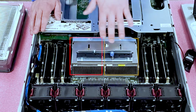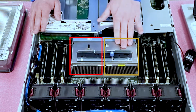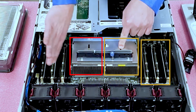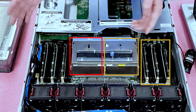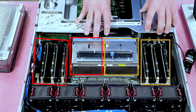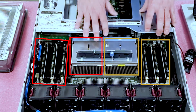There are two CPUs labeled CPU one and CPU two. For CPU one, there are nine DIMM slots. If you were only running one CPU, you could not put any memory on the other side — it just wouldn't register. If you were only running one CPU, everything would go on one side. However, with processors being as cheap as they are, we recommend putting in two procs and filling up the whole machine to get maximum performance.